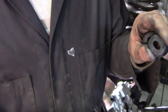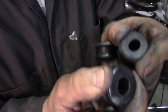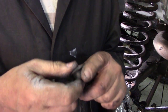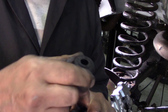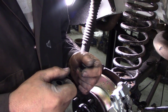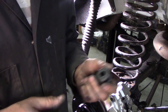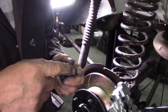I've seen too many of them fall to bits, so I put the old standard rubber ones on. Now, these are Bearmack ones — rubber. And I cannot compress those; they are rock hard. The problem is, you want some movement in your shock bushes — you need a little bit. When they're on the pin they're constantly moving and rolling around. If you put something in that's too hard, something's got to give. Maybe it's those little tin washers that give up, and then these start rubbing on the axle. So I always put the soft bushes in; they're quite easy to replace.